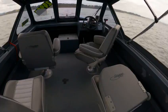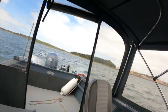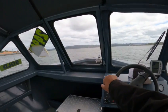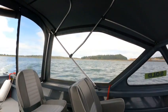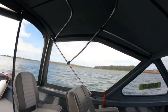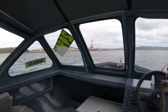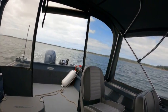I ran it for quite a while just to make sure there's no fouled plugs, because I did blow them out — both of them had been sitting a while. So I'd say if you're going to get this boat in the future, fill it up with non-ethanol fuel, run some Star Tron in it, and go out and run it at three-quarter throttle at least for the day. Then try to start it every 30 days, or use it once every 30 days.